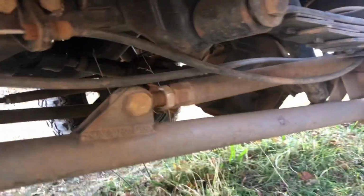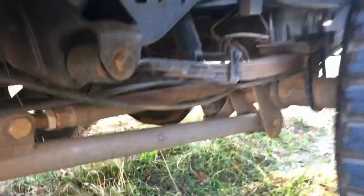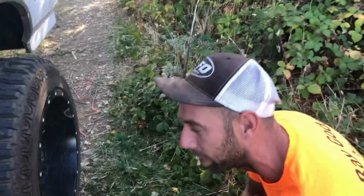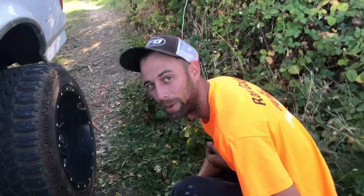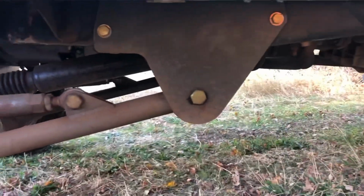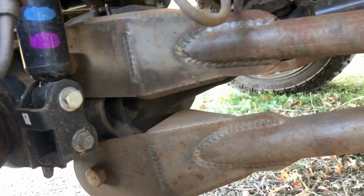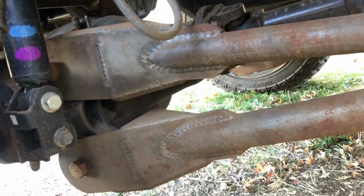I see you got our torque arms on this, or a version of our torque arms. Too much torque, it was getting a lot of wrap? Yeah, it basically snapped the old leaf springs and snapped the driveline when I tried to do a burnout the first time. A little too much power for the half. Then on the front of this thing, you built your own drop down bracket, but those are the WFO radius arms, with that real nice original rust patina on them.